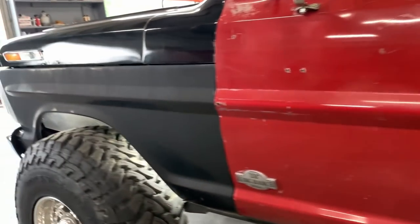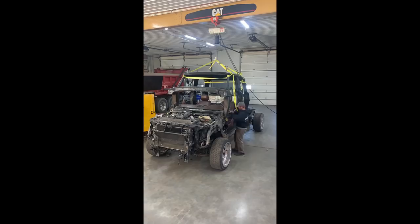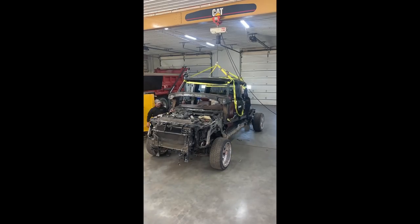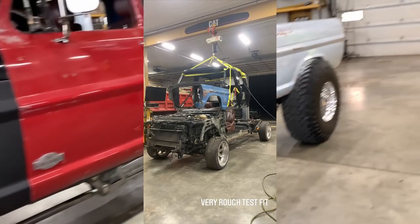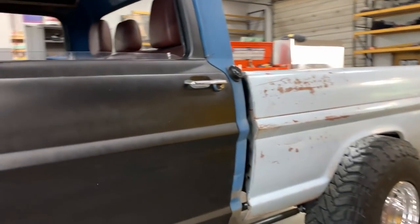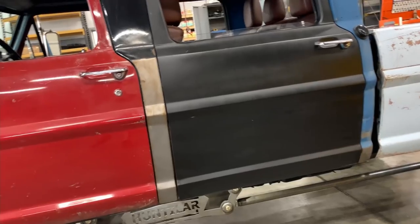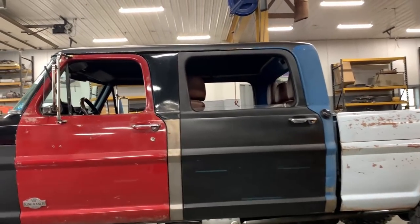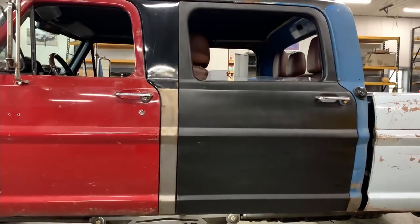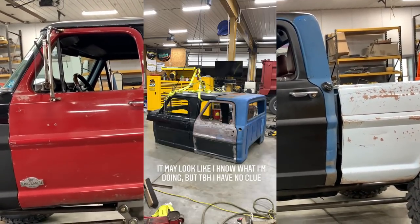I sat the '68 over top with just the upper shell of it, which got me lined up with the front fender. With a bunch of measurements and seeing where the cab would sit, I decided where I wanted to cut the cab — whether to add a section to the back like a newer Dodge Mega Cab, or put a front door in the rear, which gave me about 9 and 3 quarter inches longer than the factory '68 crew cab. I decided that putting the front door in the rear, giving me the 9 and 3 quarter inches, was a better idea and cooler.